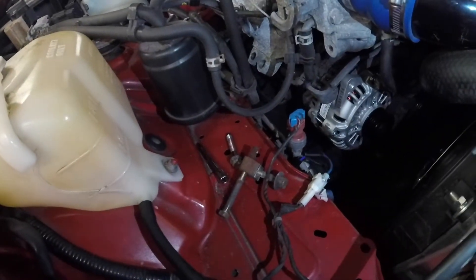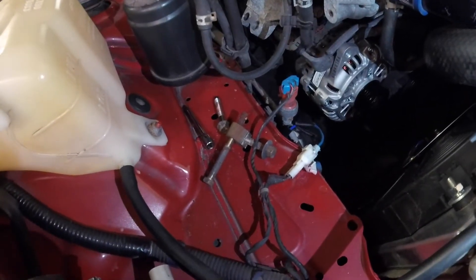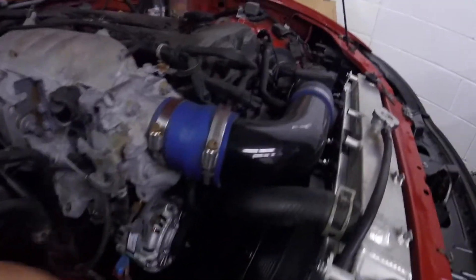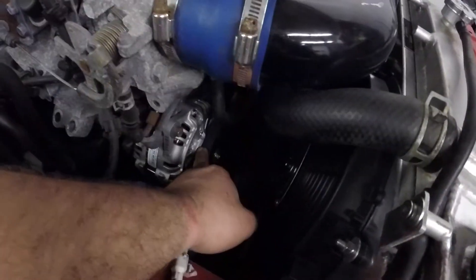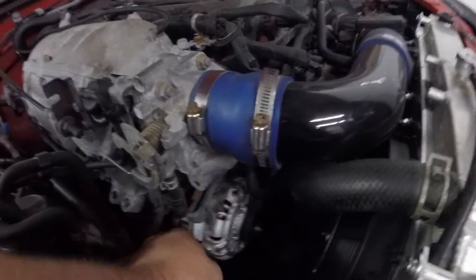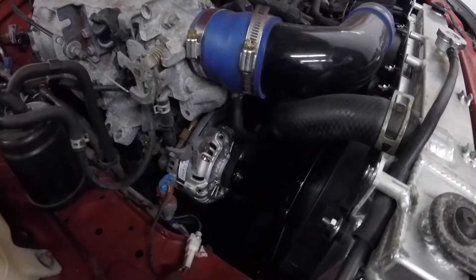I'm going to see if that bracket will slide up. If it does not, I'm going to have to grind it down a little bit to get it to fit. But the plug fit perfectly and the post on there fit perfectly for the terminal. I got it the rest of the way in. This pulley has four ribs on it. To keep the pulley straight, I put it all the way on the back one, so there's one in the front that's empty. I hooked the battery post right up — went on perfect — and then plugged the factory plug right in and it plugged right in.